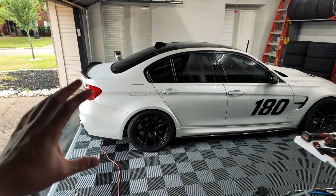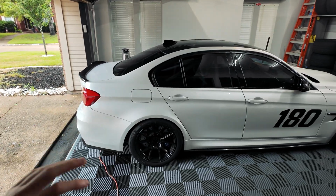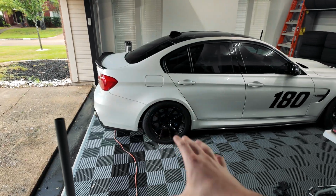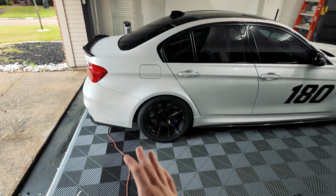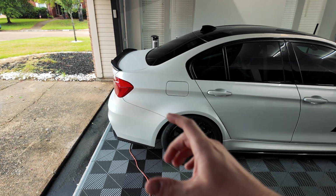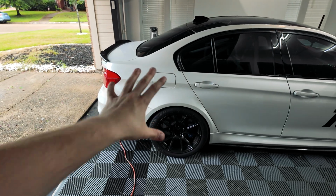So like I said, I really didn't get to film too much of the install. I didn't want to bother you guys with it, and honestly at this point I was just trying to get through the install. Overall, it's pretty straightforward, especially once you get to the SPL arms. You just take off the old ones, put on the new ones. The bushing stuff really isn't too serious on the subframe. It just takes a little bit to know where the right plugs are to disconnect so that you can lower it. And then those 4 bolts are pretty simple.